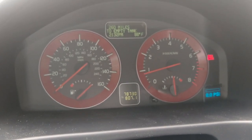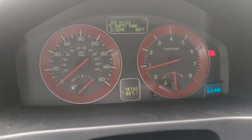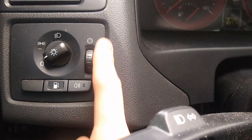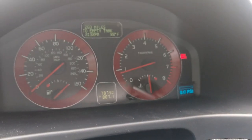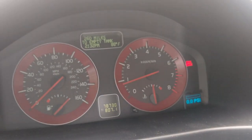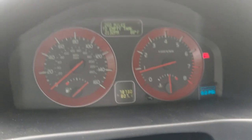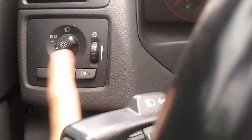The other thing I'm able to do is look at broadcast data on the bus. For this project I'm using data from the CEM about the position of the dimmer switch and the status of the headlights, and also from the steering module to see when the cruise control cancel button gets pressed. Those are broadcast throughout the entire car on the high-speed CAN bus — for example, when you dim the display, the module sends a CAN message to the instrument cluster, radio, and even the door lights to dim them all simultaneously.